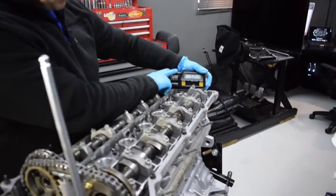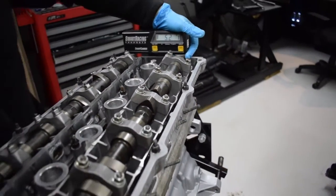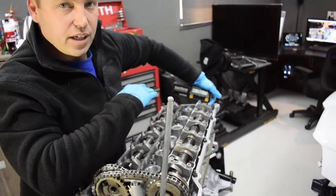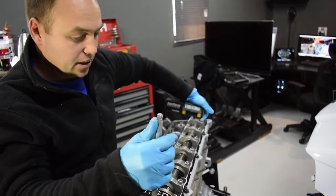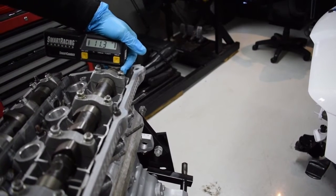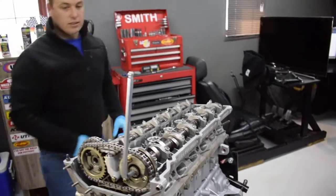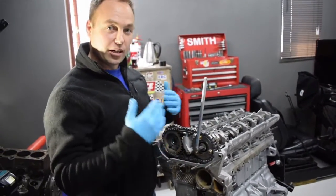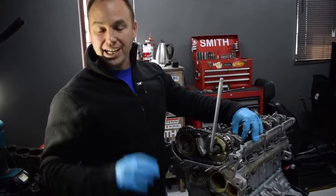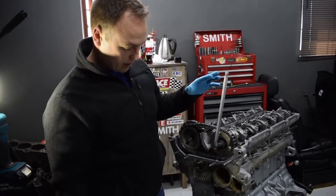We're at TDC. We're going to use the back of the cam as our zero — the angle finder is giving us about 5.2 degrees. I've got to keep this flat on the cam and then rotate it. It started at 5, went down to zero — that's already 5 degrees. We want 16, so that means we're looking for a reading of 11. That's a total of 16 degrees: the 4 degrees advance the camshaft supplier asks for and the 12 degrees for the vanos actuation. So when the vanos is actuated and the engine is spinning, that's where we should be in theory.